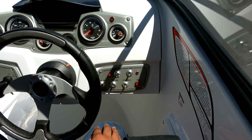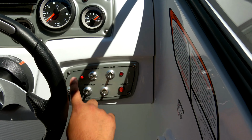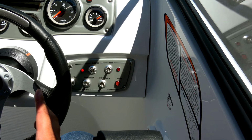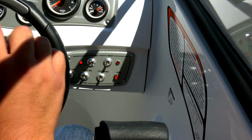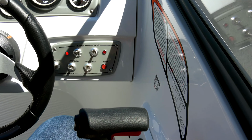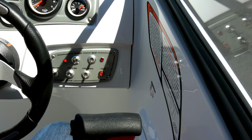What that blower does, if your boat's been sitting or it's been in storage or whatever, before you start, run that for a few minutes or so, okay? It circulates the air inside, because your motor's inside and there's no air circulation going in there. If you have gas fumes in there and you try to start your motor, you can blow the back out. It can start a fire.